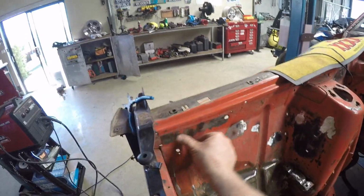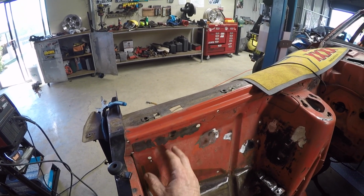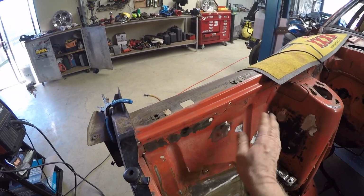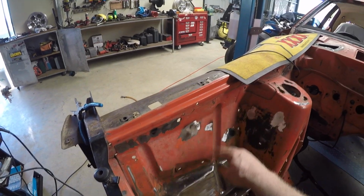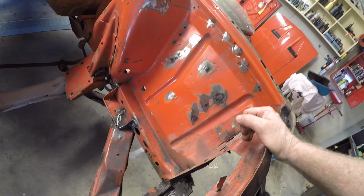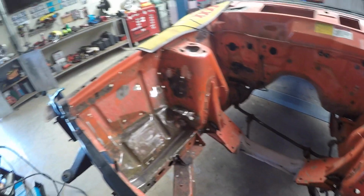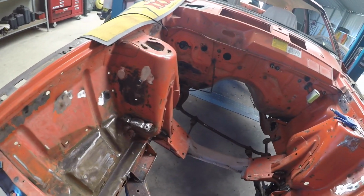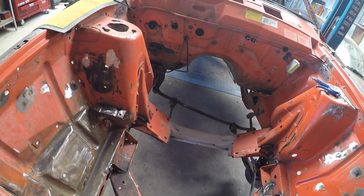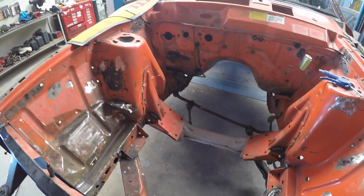I went ahead and did these ones anyway. I'm hoping to come up with a much better setup with the wiring on this car, so I took a punt that I won't need those holes. There was a bunch of other holes I've filled in. The ones that I know were there from factory, I've just left. So finally, I think we're done with welding. That didn't take long. Good eh? So now I can start the whole washdown process and some Scotch-Brite and prime the engine bay, I guess.